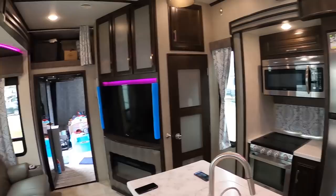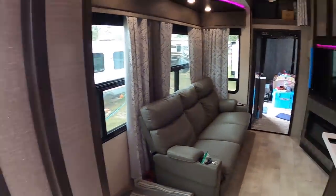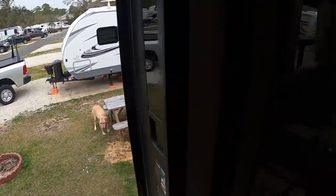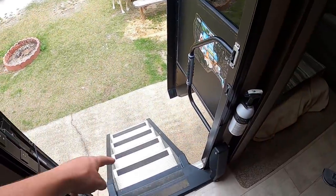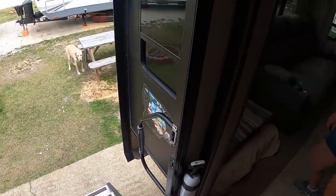Girls are strapped in and the dog is in the car. Before bringing the slides in, always leave both doors open because it will pop your ears when the slides come in. Also always make sure the entry door is open before relieving the jacks — people have been known to rip their doors off because the door is closed when they let the jacks out and the steps come up and rip the door off.